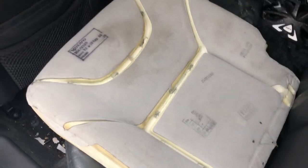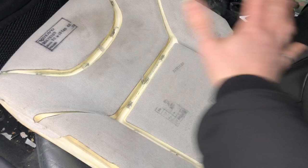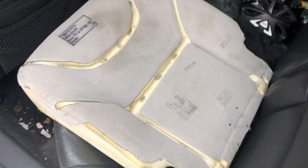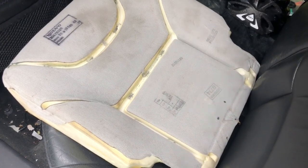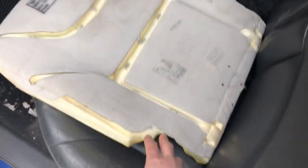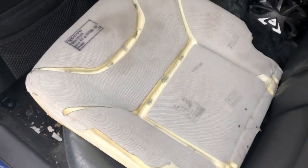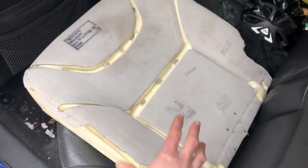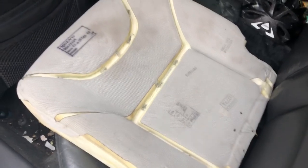One option, if you're looking to purchase a new heater pad, is to take a hairdryer to the existing one, peel it off, put the new one on, and call it a day. The heater pad's not that cheap, so I went with the wreck yard option and did not feel like peeling the old one off. I took the whole pad and seat out of the donor vehicle, and my plan is to replace both without needing to remove the heater pad itself.